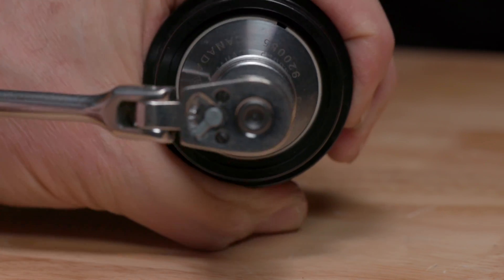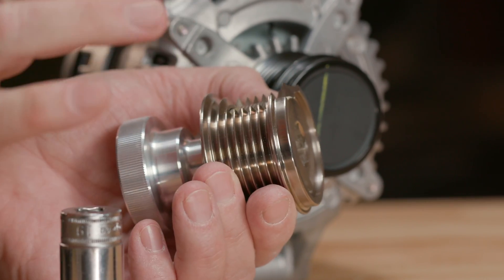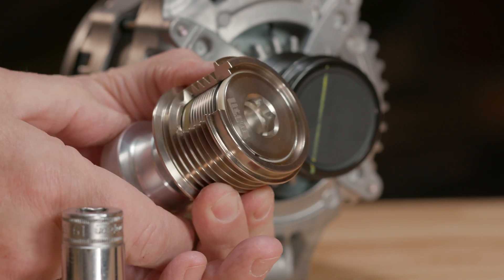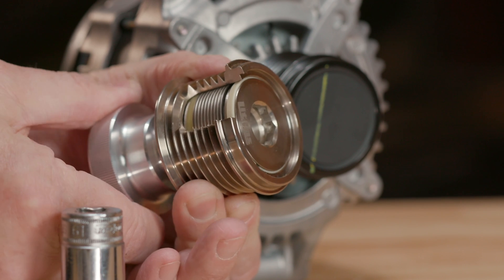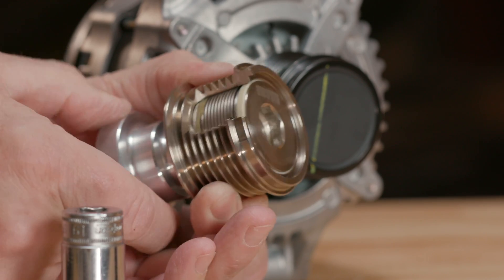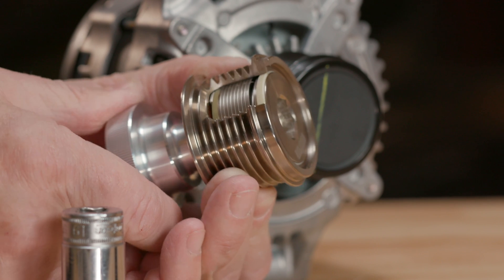Litens has provided us with a nice visualized cutaway device — a section cutaway. This is an OAD, and although I mentioned they're usually black, this one is just for demonstration. You can actually turn it to feel the free-running portion, and then turn it back. There's an extremely lightened spring inside so we can demonstrate how it works — I'm able to hold the pulley, turn up against that spring, and it's super light, again just for demonstration. The real unit has a minimal amount of movement in that heavy spring based on the vehicle's requirements.